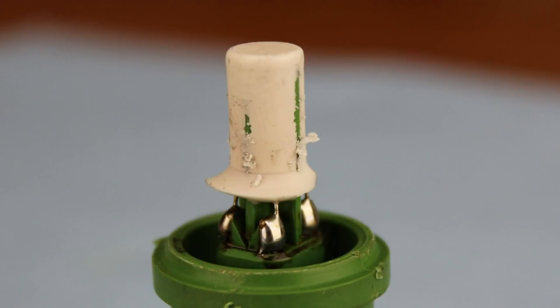And like I mentioned, I've replaced tons of these sensors. This is actually the very first time I've cut one open to take a look at what it looks like inside. So how do the engine coolant temperature sensors work? Well, inside the housing is something called a thermistor — it's basically a thermostatic resistor. So as temperature changes, the resistance value changes. In this case, it's an NTC, or negative temperature coefficient thermistor. So as temperature goes up, the resistance of the sensor actually goes down. The values are then sent to one of the computers — either the ECM or the instrument cluster — and are interpreted by the computer to represent a temperature value. So at every temperature, there's a given resistance value.